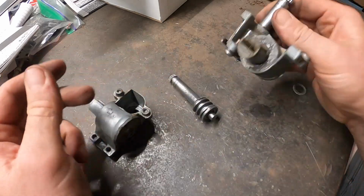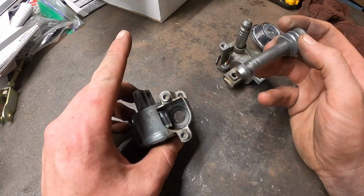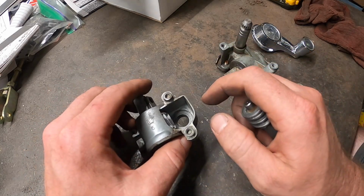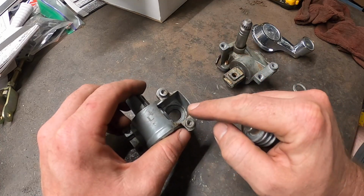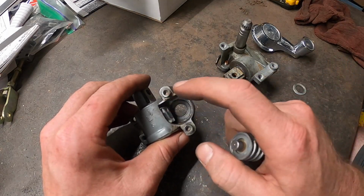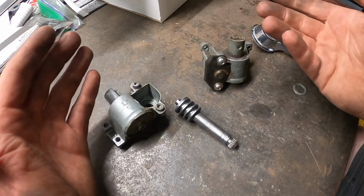Like butter. Just a quick explanation of how to fix it. Obviously, clean everything out. We wire brushed everything, rinsed it out with some brake parts cleaner, dried it off, put some red and tacky in there. Actually, back up. First, grind, drill, tap, because you don't want any grinding dust or drilling, tapping chips to get in there. Clean everything out, pack it with grease, put it back together, vent window fixed.